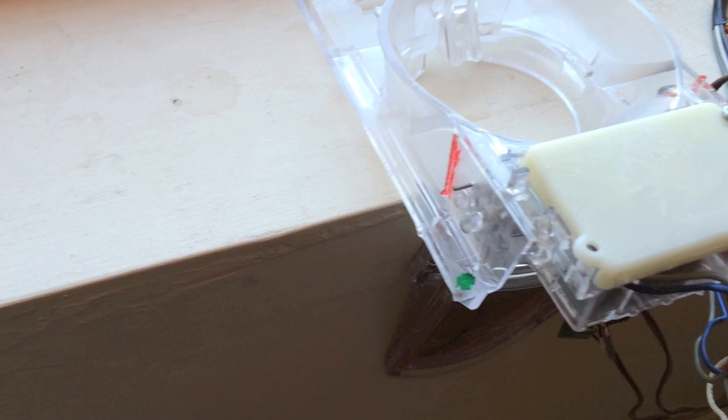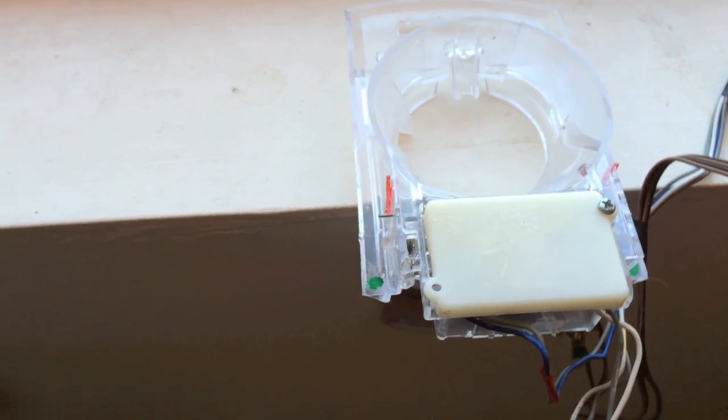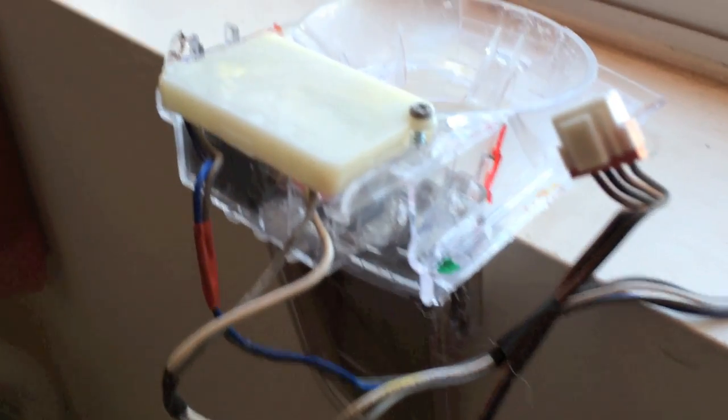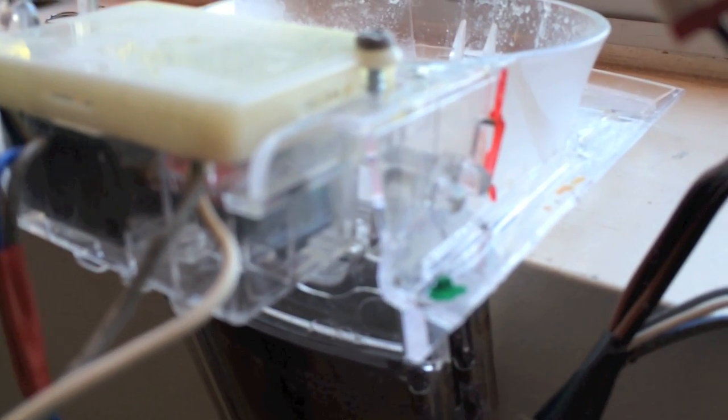Four things stopped me. First, two little nipples at the far end away from the display that fit into indents in the metal piece. Worse, the vertical tabs on the sides. Water corrosion on the metal had raised its surface such that the vertical tabs would not allow movement. I used clippers to remove these tabs.